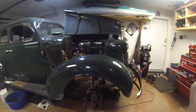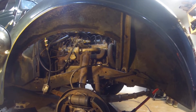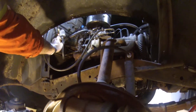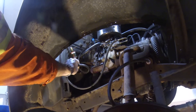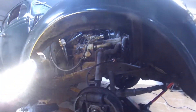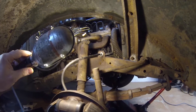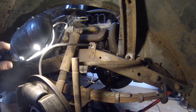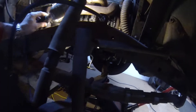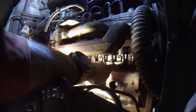So I just want to show you what I did here. I removed the two pieces — this car has a fender well with a removable window — to allow me access to the valves. On the flathead, the valves are on the side of the engine. On older, high-service engines you're likely going to find a fair bit of sludge inside here. There's some sitting on the block here — not bad.